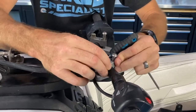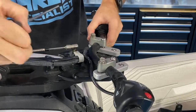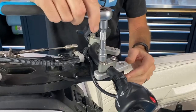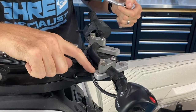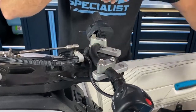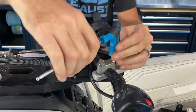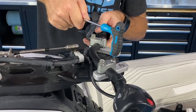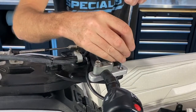I'm loosening this bolt so I can wiggle things around to get everything seated. I've got everything a little bit loose, not tight. I'm going to start with the front bolt and get this pinch bolt somewhat snug. The gap on the front of the clamp is going to be tighter than the gap on the back — that's how it's designed. Then I'll come back to the provided button head bolt and tighten it up, putting some torque on it, and then go back to the last bolt.